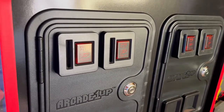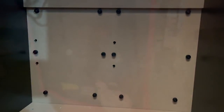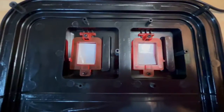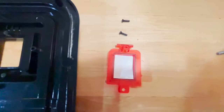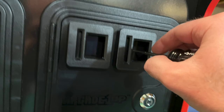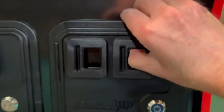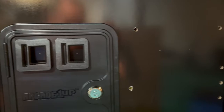To install them, I first removed the two molded coin door panels from the cabinet. These are held in place with a dozen screws and mounting washers. With the coin doors out of the cabinet, I removed the small mounting screws that hold the button inserts in place, then carefully popped them out of the panel. With its buttons removed, I placed one of the door panels back into its alignment holes in the machine. I then used an awl to mark the button centers with starter dimples for drilling the LEDs' holes. I used the same door to mark all four locations, so you really only need to remove the inserts from a single panel.